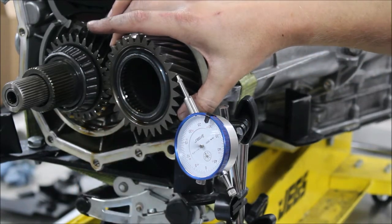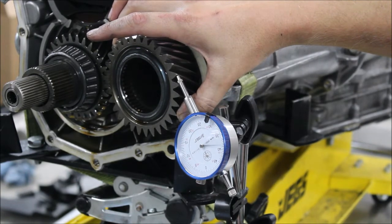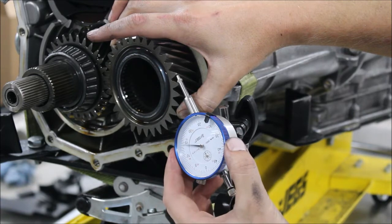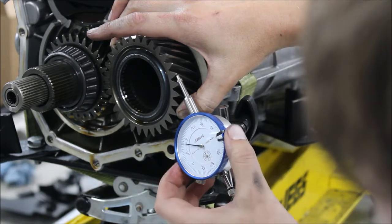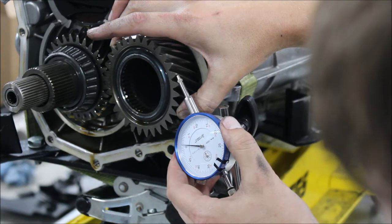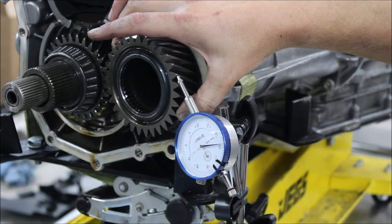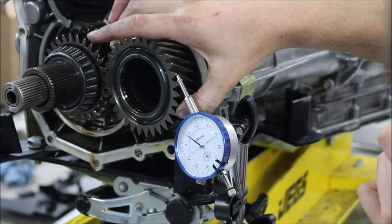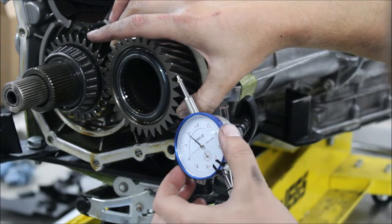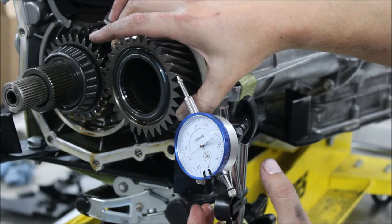You want it making good contact and about as flat as you can get. You don't want to measure it at an angle — the angle needs to be lined up with the direction that the teeth are moving. Then you want to feel the play, and at one end of the play you need to zero out the gauge. Go from there to there — turn the gauge until you're reading zero. Now go back and forth, and wherever it reads, that's your backlash. I'm reading about 25 thousandths of backlash.